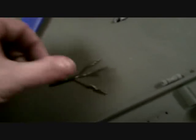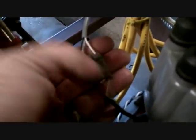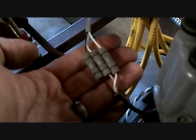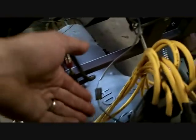They use the Molex connector — one of those things with three pins. It's used on a lot of things, but they suck. They fall out, they fall off, they corrode. So I trimmed the lines back and the three Molex wires are gone. I got three of those little gray barrel connectors. They hold nice — incredibly nice. And if I had to take the body off and disconnect the distributor, I don't have to root wires back through the firewall. I can just disconnect it.